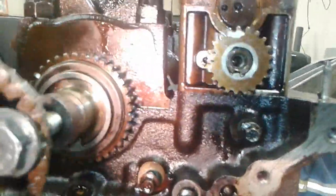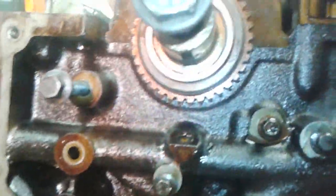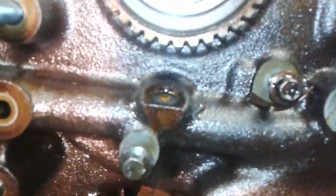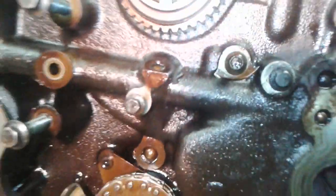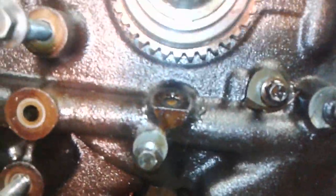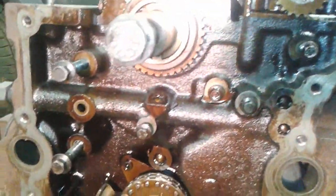And we know that is approximate when that keyway is in line with that oil check valve ball on the oil passage of the engine block. I'm going to maneuver it just a little. And we can see that the keyway is approximately parallel and in line with that ball check valve of the engine block's oil passage.